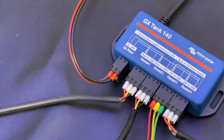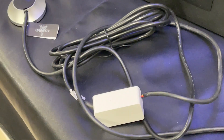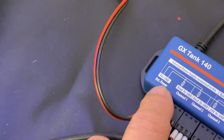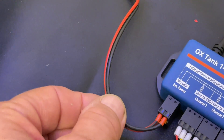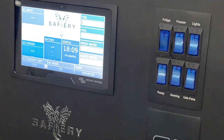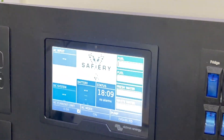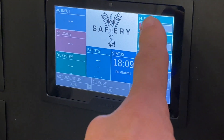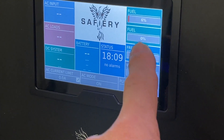These sensors here are currently running at 12 volts, so what we have to do is come in on this side and run a little 12 volt power supply. Then we come to the display, and on the display — soon to be announced — there's going to be an overview that takes up all the tanks. You can see here what we've got: the fuel and fresh water.